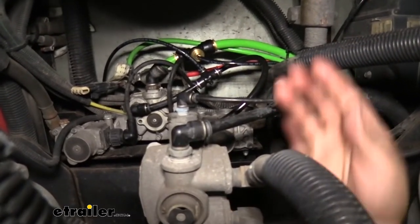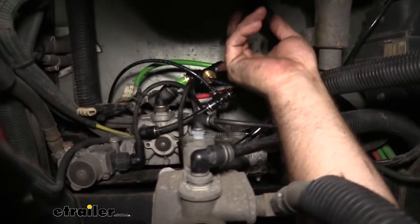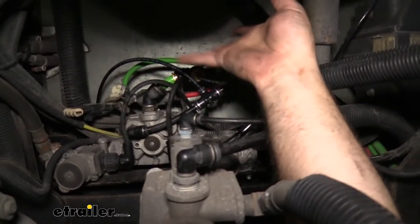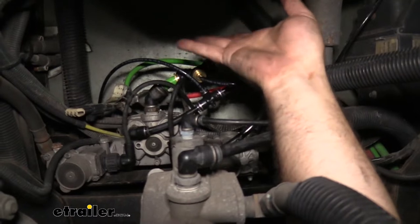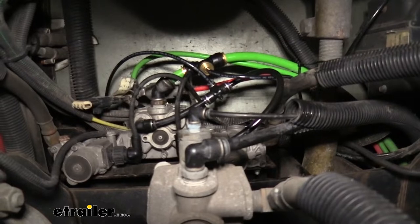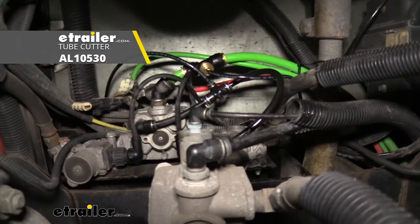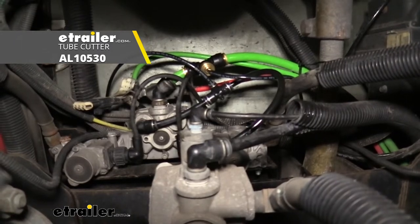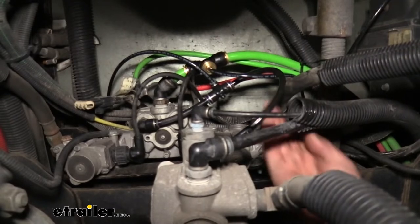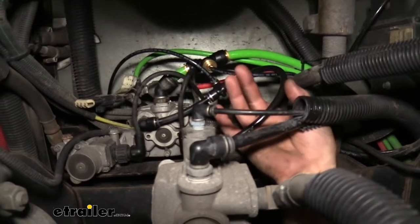Your supplied air is generally the large-diameter green hose that matches the push-connect diameter that comes in the kit. Once you've found both lines, tie into each one by cutting them. When cutting, don't use just a pair of wire snips — use a tubing cutter or a sharp razor blade for a nice clean cut, which ensures a proper bite onto the push-connect fittings and prevents leaks over time. I went ahead, cut the line, put the T-fitting in, and fed the hose over to the tank.